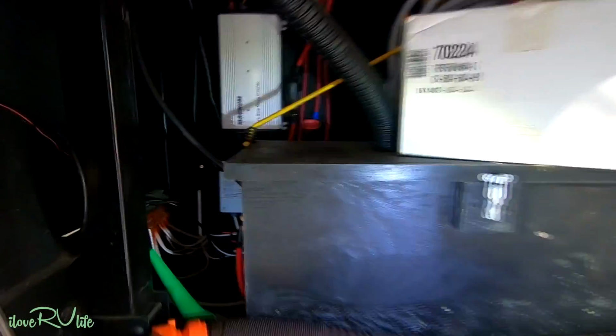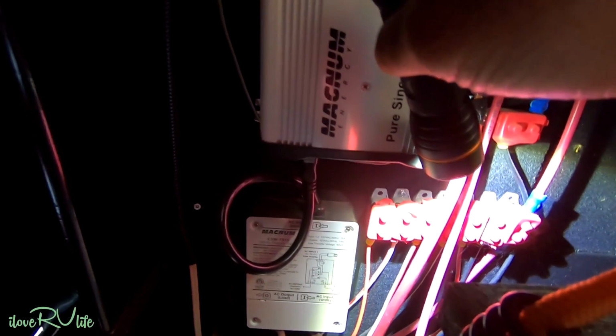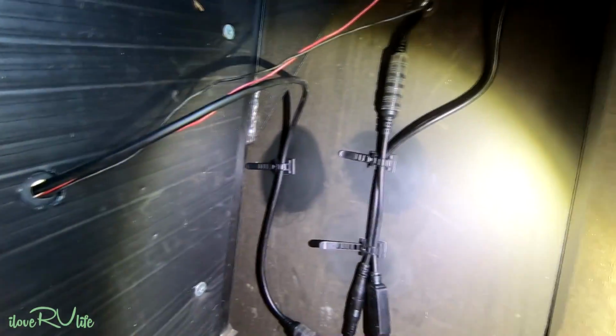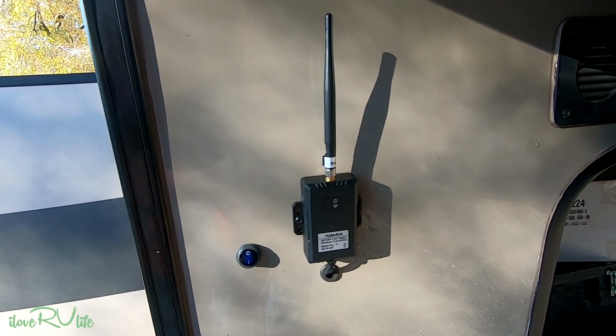This is the front of the fifth wheel. It's going to be a little dark. Right here at the bottom you can see where I brought the cable in. It's located right here. And then, if you'll notice here, I had a fuse block that I was able to power the unit with. And then I came here to the side and just drilled a 3/4 inch hole, and you'll also notice I'm using a rubber grommet around those. You can buy those things for pennies a piece to protect the wiring. You can see where I'm actually bringing the wire in. And then there's the adapter cable that you're seeing right here. This is where you actually do the power insertion. And then there's the repeater that's located right there. So I'm literally maybe 10, 11, 12 feet max.